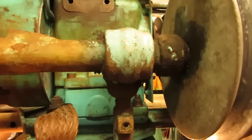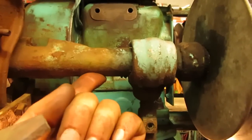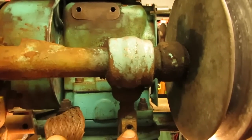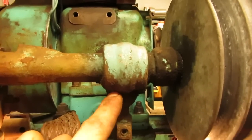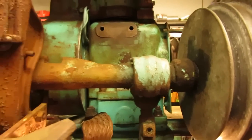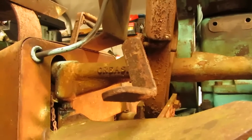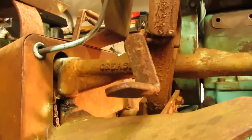And after that is done, you also have to move this foot here upwards. As you can see, when the shaft goes up, that has to go up as well. Has a small set screw here, and you can wiggle this up a little bit, retighten the set screw, and then everything is moving on the same level and nothing is jammed up. And of course your chain has tension on it again.